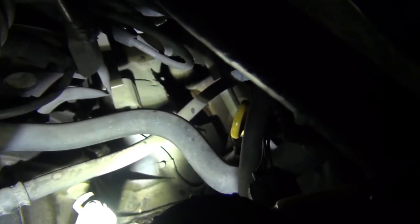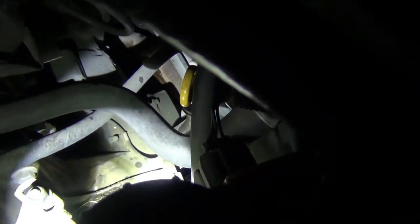I'm going to try to pull out my VSS Vehicle Speed Sensor and show you where it is. I don't know if you can see down there — it's down below my dipstick. Here's a plug right here. Right there is where it plugs in, and there's a middle section, and farther back you can see there's a metal casing over it.